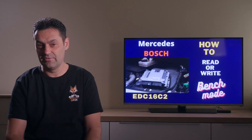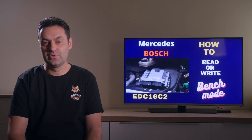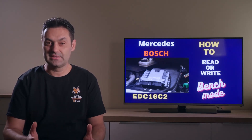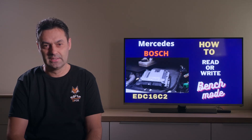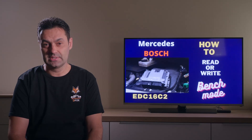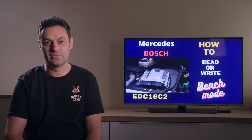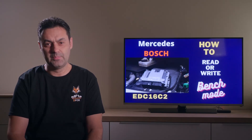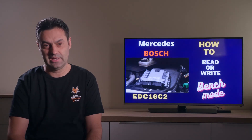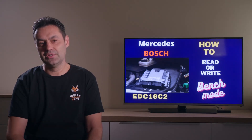If you want to have a real archive of the original software in full and to work free of headaches, please bear with me for this tutorial. First, you have to remove the ECU from the car. Some of you may say that the first step is to remove the battery, and maybe they are right, but if you are doing the work carefully and if you are an experienced specialist, this is the fastest way — because disconnecting the battery sometimes leads to a problem with loss of power steering calibrations and other codings that you will have to deal with later on. Anyway, with the ECU in your hands, we can continue.